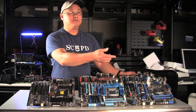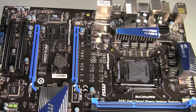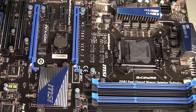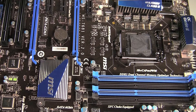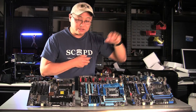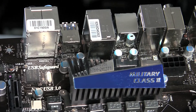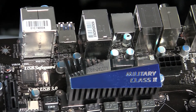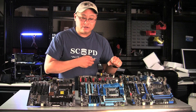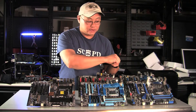You move up a little bit, you get MSI's P67A GD-65. What this does give you is additional SATA ports — it has four SATA-6 ports and four SATA-3 ports. It also gives you two USB controllers, so it has a total of four USB 3 ports: two on the back, and two using a header with a little dongle that runs out the back.